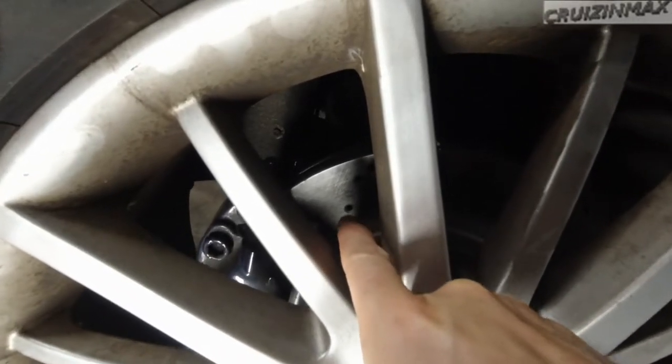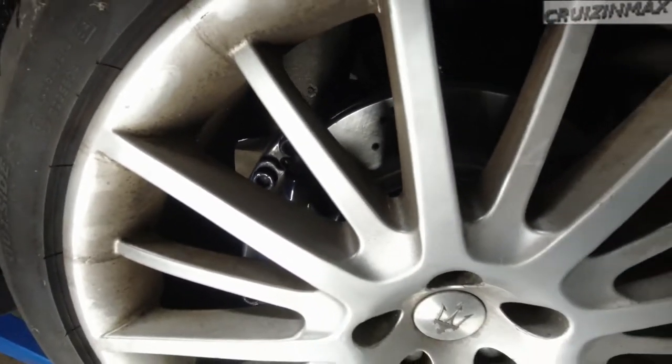So I was doing the rear brakes and you're not going to believe it. Well, now you are because I just took the front brakes apart. But the guy came to me with a grinding noise from the rear, and as you can hopefully see, these rotors are brand new as well as the brake pads. Now what happened was, when somebody comes to me with a brake problem and the car has rims you can see right through, you can look at the outside pads and see how much they're worn. So that's what I did — there was a lot of pad left, at least 70% on the outer. But got on the rack, looked at the inside pad, and I could see that the rotor is eaten. It's metal on metal action.